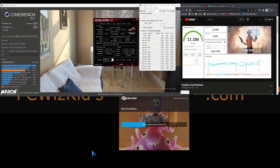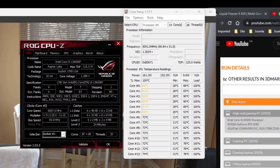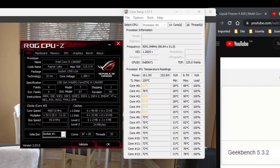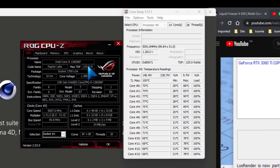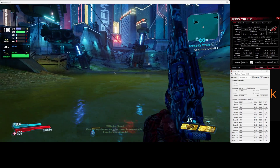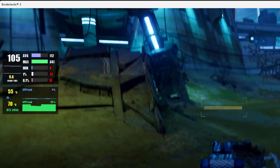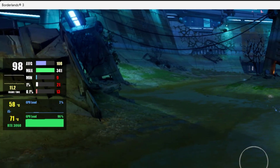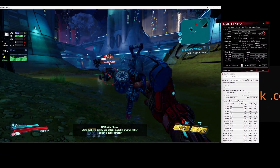I'm not going to really run things like Blender rendering and Cinebench all at the same time, but if you're curious about killing the processor and running it at 100% load on all 20 threads, here are the results. On the efficiency cores it's running around 75 degrees Celsius, and on the performance cores it shoots up close to 85 to 90 degrees Celsius. When playing games, the system runs pretty cool — roughly about 45 degrees Celsius on the CPU — with the GPU doing most of the work.